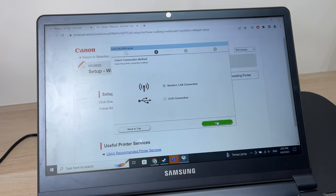Now go to the Start button on your Windows computer, click on it, then go into Settings, then Devices, then Printers and Scanners. Tap the plus icon and the Canon printer should appear in the list — MG3600 series. Click on it, click Add Device, and wait until it's connected. You should then see your Canon printer appear under Printers and Scanners. You'll see two of them — click the one with WS if you want to scan.